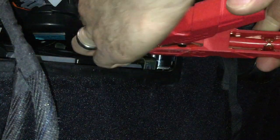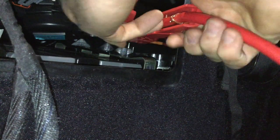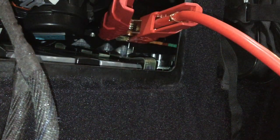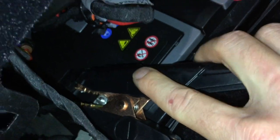This is the battery pack we use here. With your positive lead, just feed it up underneath that little black cover, lift it up, and then just place it on. It doesn't have to be the best connection in the world, just as long as it sits on there and creates a contact. Place it onto the 10mm nut which is located on the battery. Again, it doesn't have to be a great contact, just enough to wake the vehicle up.